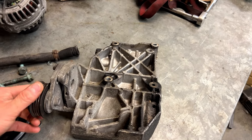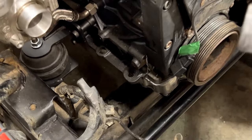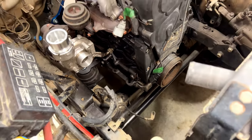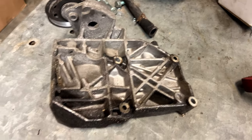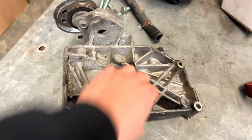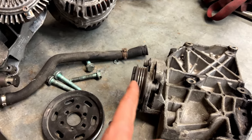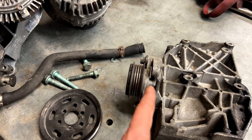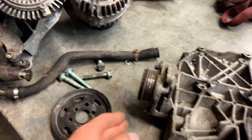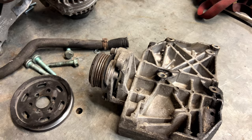This is where this crusty guy comes in — the AC compressor mount bracket that goes on the passenger side of the engine. My buddy who I sold my 22RE to has a couple of Toyota power steering pumps, and I'm going to do my best to adapt one of those to this bracket. I already have this tensioner that'll give me a good baseline for pulley alignment. The Toyota pump uses a v-belt while this is a serpentine belt, so we'll need to figure out a pulley adapter.